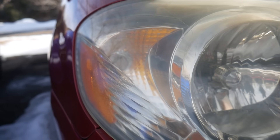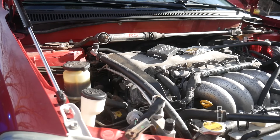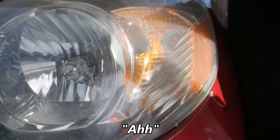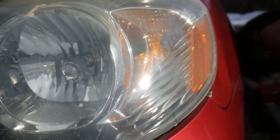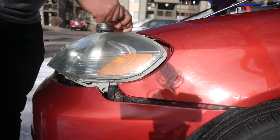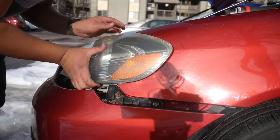Front turn signals are easy as well. Just twist the bulb socket out of the headlight housing, take the old bulb out, and push the new bulb in. Check to make sure it works — it does. Reinstall it and do the other side. The second one was stuck in there, so I just took the whole headlight out — probably not necessary but since I'm weak, here I am removing it to get more leverage. New bulb works, so let's put this back together.